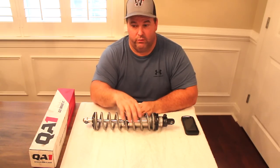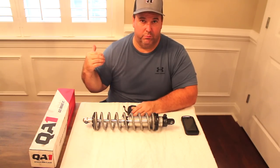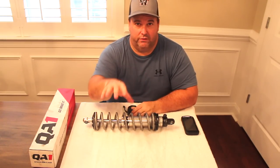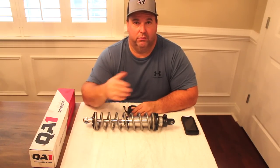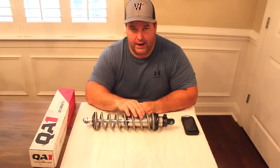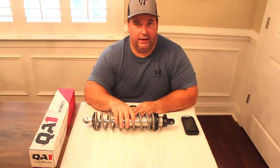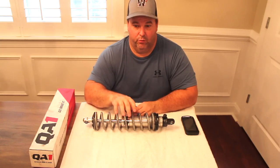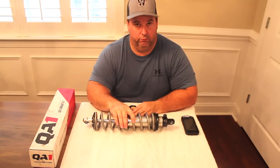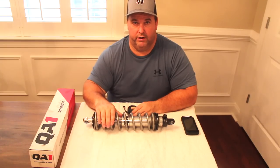Because of weight we've added by moving the radiator to the rear, building the rear spoiler and wings, the battery, and a vented puke tank in the trunk for the 871 blower on methanol — we knew we were adding more weight to the rear, so I did go to a 150-pound spring. When I get the car ready and set it down, if I don't have 25 to 30% spring compression, I will regroup. That's very important — you're looking for 25 to 30% spring compression.